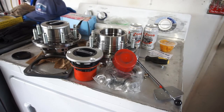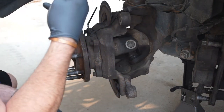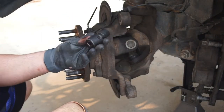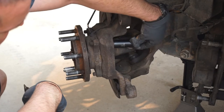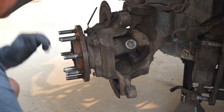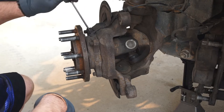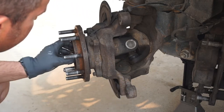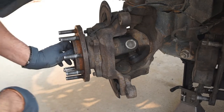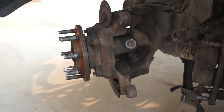Let's go pull that front wheel bearing off. All right, let's get to taking this off - needle nose pliers, or whatever you want to use. I have an 18 millimeter swivel wobbly socket, or you can use an 18 millimeter straight to get the bolts off. 5 millimeter Allen wrench to take the sensor off. You will need the one and five-eighths inch socket to get the axle nut off, because I'm gonna try to leave the axle in there. Let me get to taking it all off.